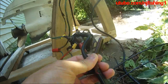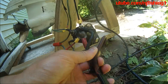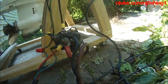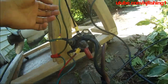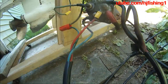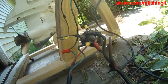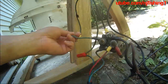Remember, you need to get a spare cable here. The red color for positive goes to the big screw on the car solenoid. And the black color cable goes to the small screw for the solenoid. Then you connect the black color to the engine. And the green color connects directly to the green color without connecting to the solenoid. But the blue color, you will have to connect the blue color wire from the remote control to the engine.